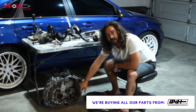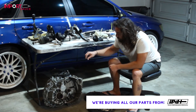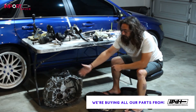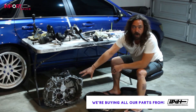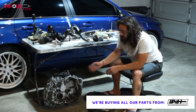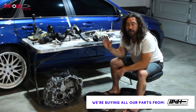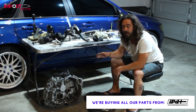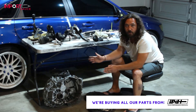When you buy the clutch kit, a new slave cylinder comes with it. One of the biggest failure points is the clutch bite pipe — it brings clutch fluid in from outside and feeds it into the slave cylinder. These are notorious for going bad, and if they do, you have to pull the whole transmission just to replace this $40 plastic line. Also do your axle seals — $6 to $18 each — and make sure you have extra transmission fluid on hand.